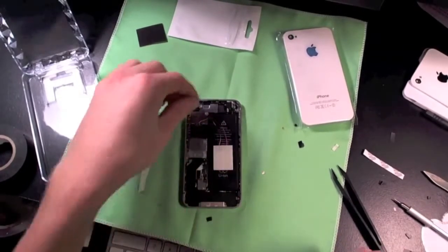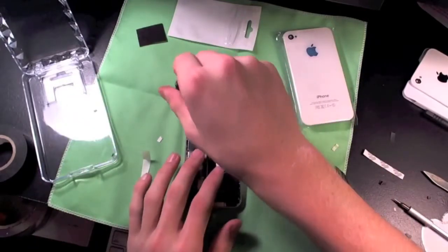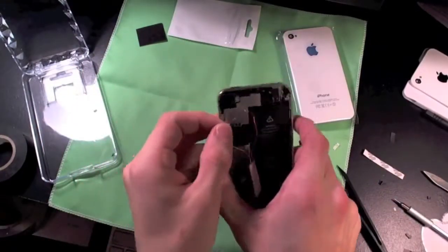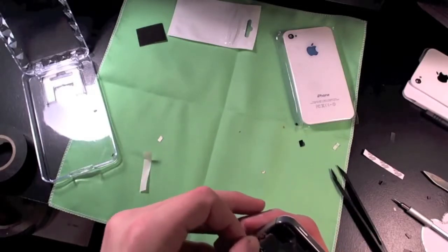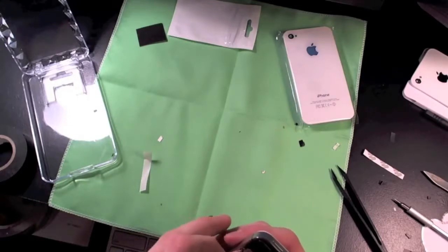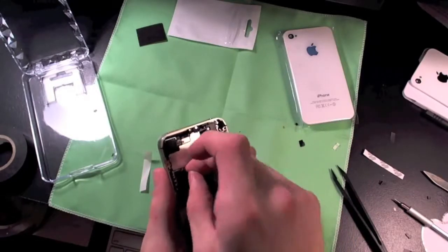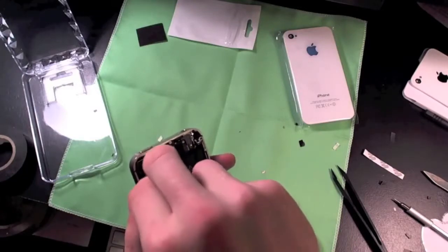Now that we've got that square on there, you're going to want to take the little hook bronze cable that you made, take off the one left-hand side screw, open that a little bit, and just notch this around there under the screw so it will stay on. I know in the KO Gadget video it shows you doing it on the right-hand side, but do not use the screw they show in the video because that is actually the WiFi antenna screw, and there have been a lot of instances where people have lost their ability to use WiFi on their iPhone because of that.